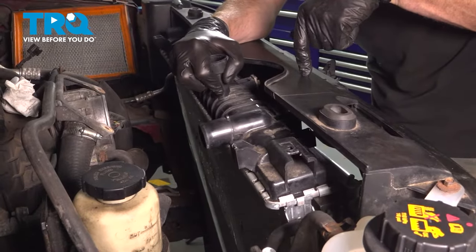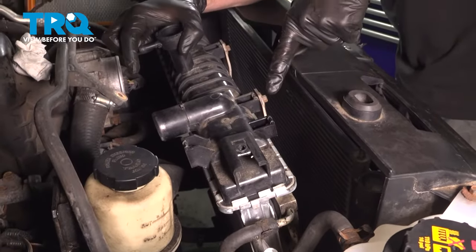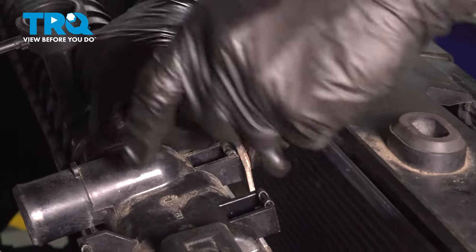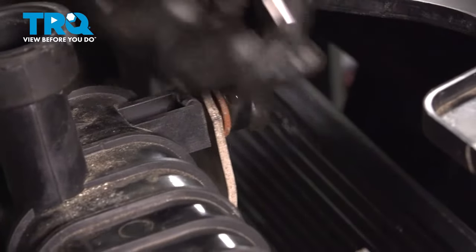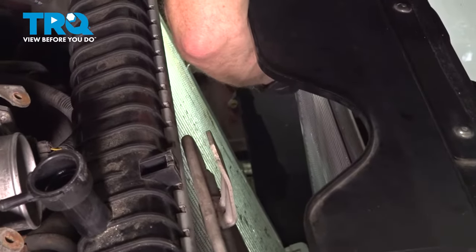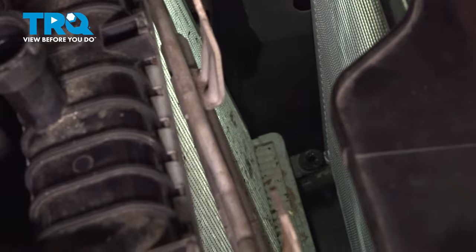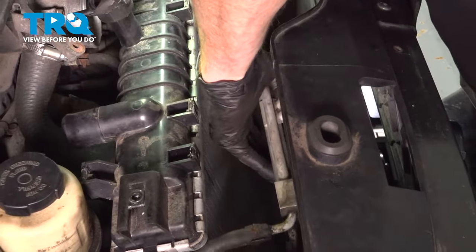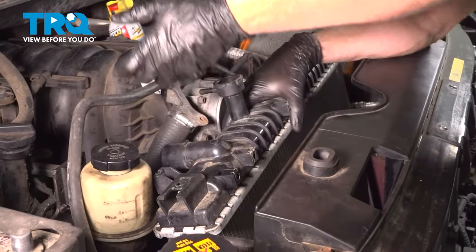Go over and do the exact same thing on the driver's side. Now that we have both the brackets out of the way, you can wiggle the radiator around. We're going to try to lift this up out of its lower bracket area. Now we can move it just enough to gain access to our last two eight millimeter headed bolts across the front. We're at the point that we can reach down, grab the AC condenser, and lift it up from the bottom corners of the radiator. Once you lift it up, just slide it forward so it's not sitting in its connection point. Once you've done the AC condenser, we're going to continue on to this cooler — just lift it up and slide it forward. Now it's time to carefully grab onto that radiator. We're going to lift it up from its lower mounting points, slide it towards the engine, and then lift it up and out of the engine compartment.